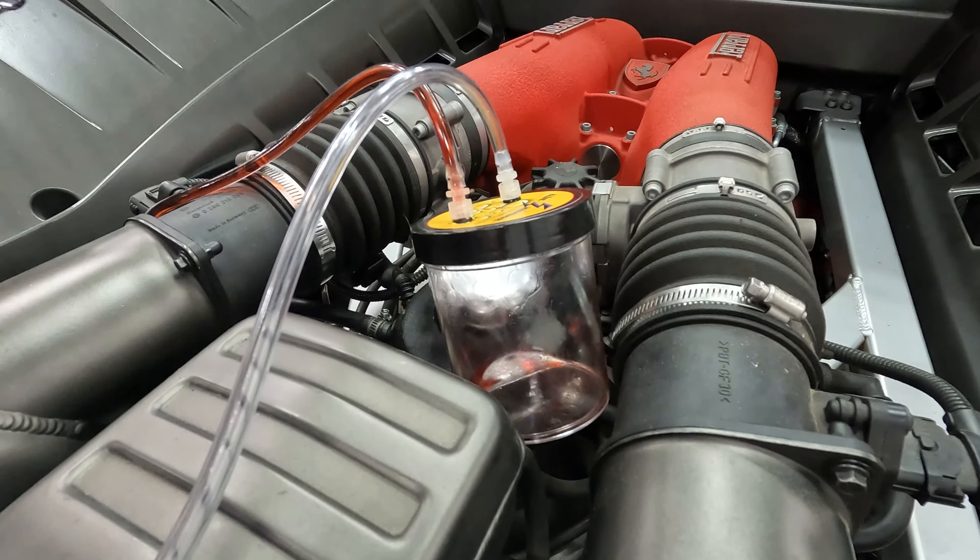Ready — and crack. That's a good little dribble, much more controlled this time. The good news: I'm not seeing any air anywhere in the line. Alright — we got the air out. Nice, the little air bubbles are gone — that's what we wanted to see.